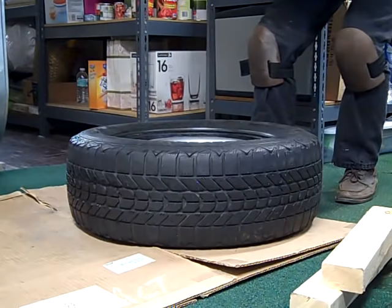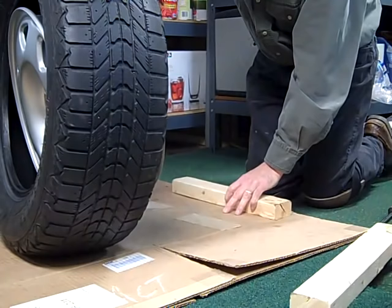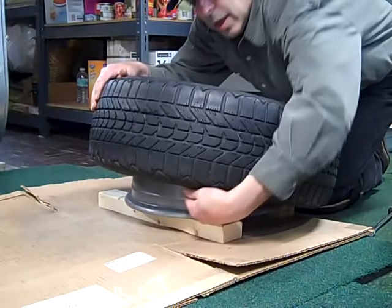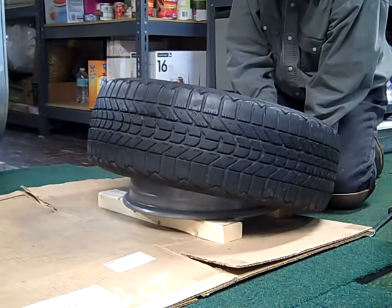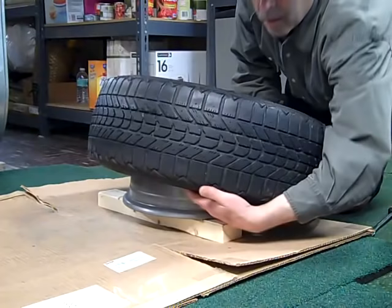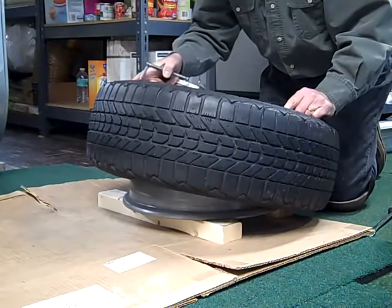That just goes pretty easy. Now for the trick of the matter — I've got a couple pieces of wood here. When you're on the ground, if you don't have your wheel elevated a bit, you're going to fight against yourself. When you're pressing down on the tire, you're pressing it into the ground and can't use the recess. You want the tire tilted at an angle. By elevating it, the end closer to you can drop down, and you can compress the tire down to follow along in the recess. That's really the key to the whole thing.